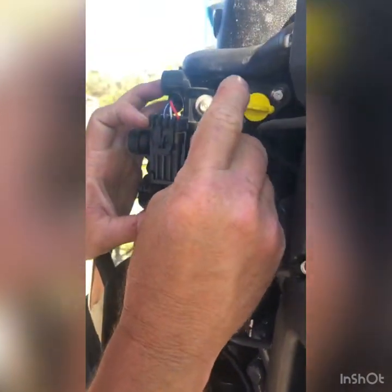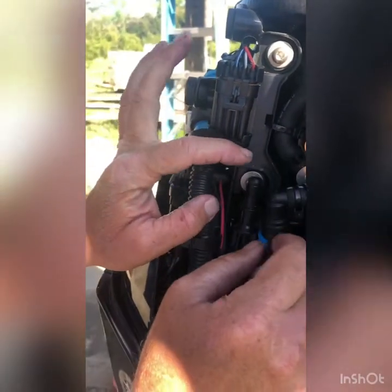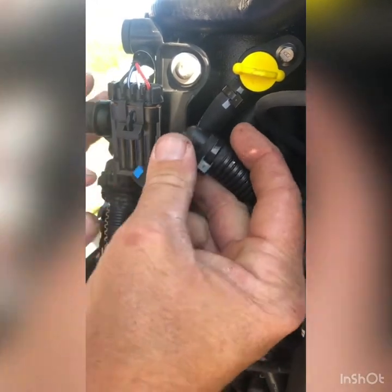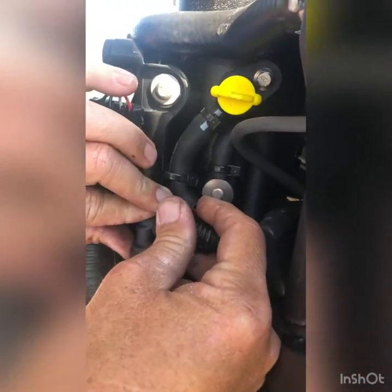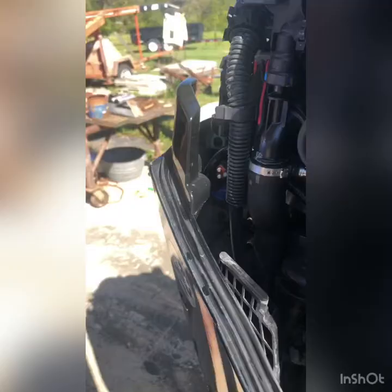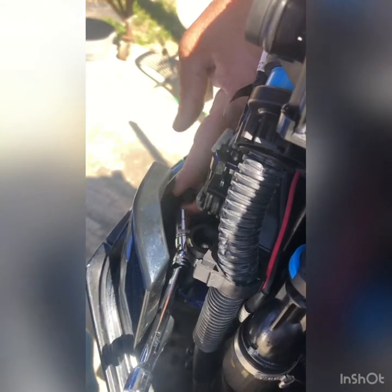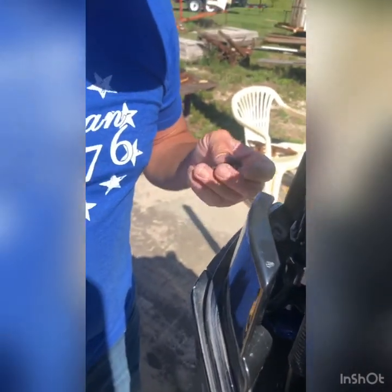I was talking to my pal Daryl Davis and walking him through this process. He said there was a bolt on the top of this particular piece, but I haven't seen one like that — I don't usually get to play with the brand new stuff. Anyway, there is another bolt all the way down here and we'll get to that one in a minute. With a couple of quarter-inch drive extensions and a swivel, you can more easily reach it. Trust me — my buddy Adam Taylor and I, that one bolt right there probably took a solid 30 minutes to get into and it was no fun. We had no alcohol — it was a bad day.